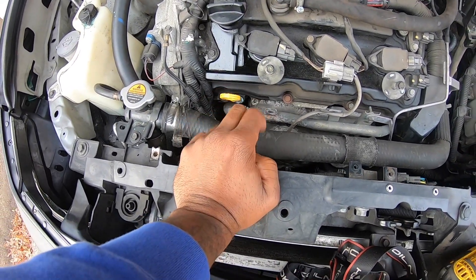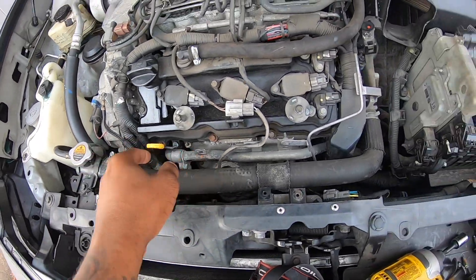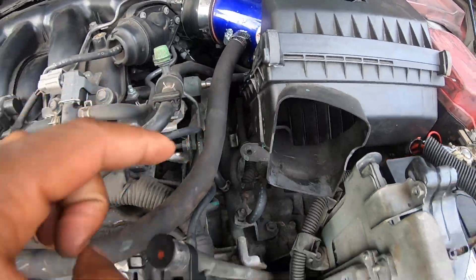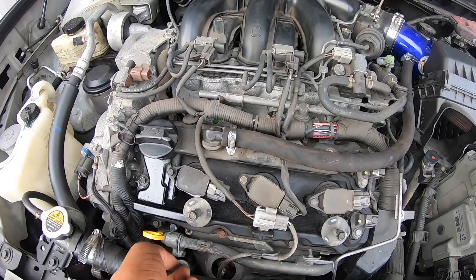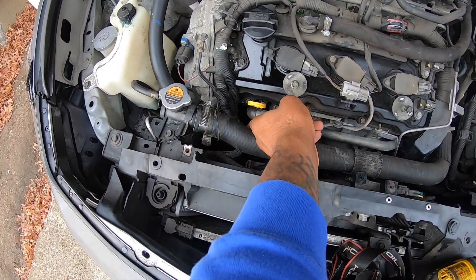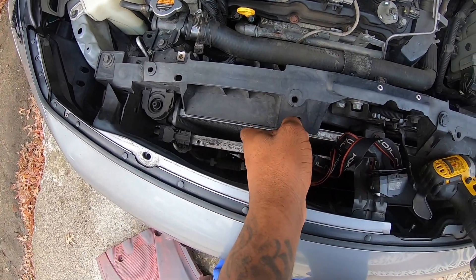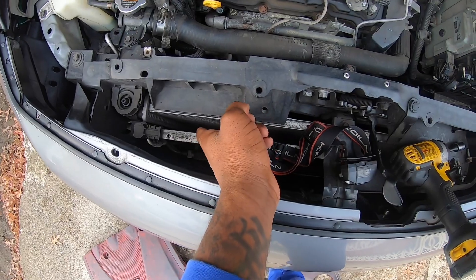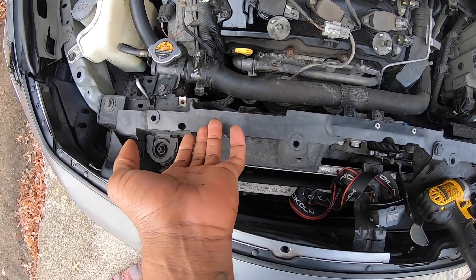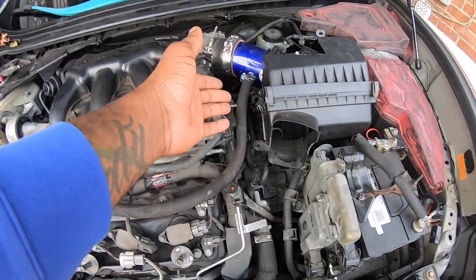You can bring the hose all the way out, but before you do, fluid will run out. If you can, let it run out a little bit — drain some out. If you can't find the drain plug under the radiator, just let some run out. Then set the hose up there so it doesn't splash all over, because I made that mistake and mine splashed all over the engine.